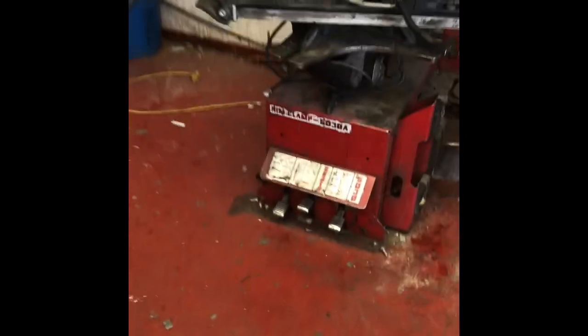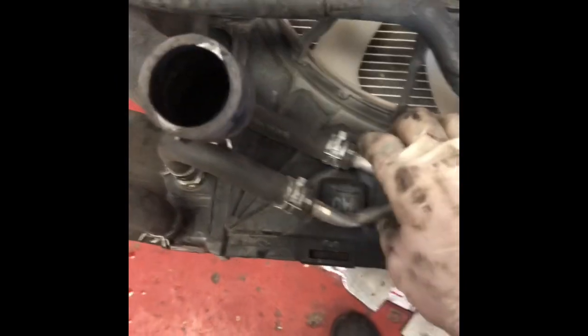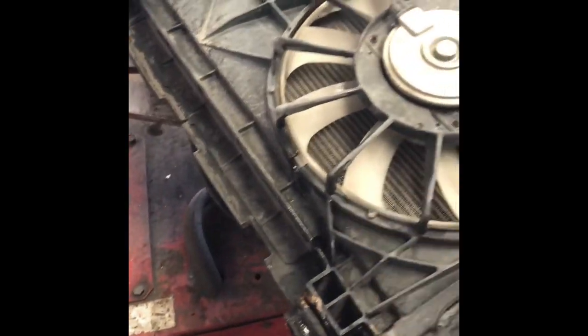You are going to have to swap over the cooling fans. Put the old radiator up on a table or something. What you're going to run into is these cooling fan shroud clips — you don't want the fans to come off by themselves. Just take it off from here and here, move this piece as well, and you can take them off. There are just two cans underneath — take the cooling fans off and then swap them onto your other radiator.